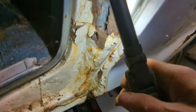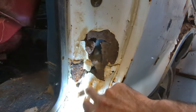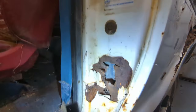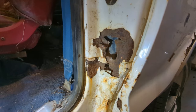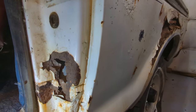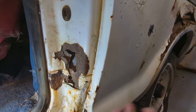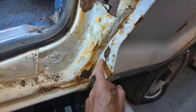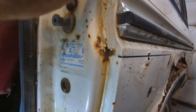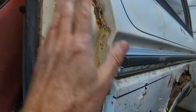This door jam needs some attention. That was another decision — it was helpful in deciding whether to use full panels or not. When I have this full quarter panel off, I gain access to this whole area, and I believe I might get access to that rear mount. This whole area here needs a fair bit of work — this looks bad up here, but it's not rusted through, it's got pitting. Once that quarter panel's all off, we'll be able to address all that stuff. And in here there's some swelling — something happened in here, and this whole section will have to be rebuilt.